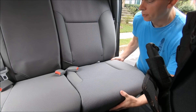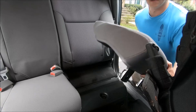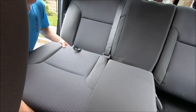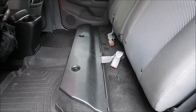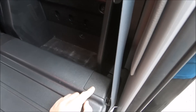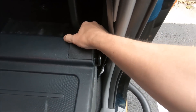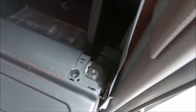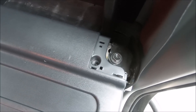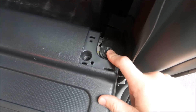With both bottom bolts removed, you can see the bottom piece — get the seat belts out of the way — it just lifts right out. We're already a third of the way done; look at all that extra room. Next, lower the seat and you'll see these two squares on either side. Just get your fingers under the back right there and they should pop right up. If for some reason they don't, use a trim tool and give it a little jiggle. Once those caps are off, you'll see another 14 millimeter bolt to remove.